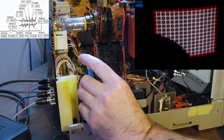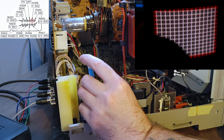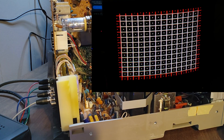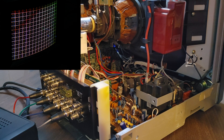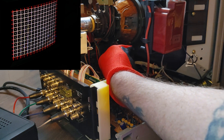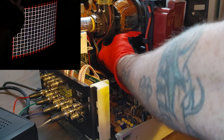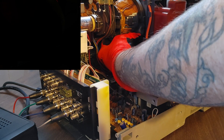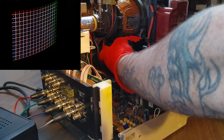Now I'm stretching out that vertical size. You can see we got the horizontal and vertical sizing down pretty well, but we need to bring that left corner down by turning that yoke. I'm going to crack that yoke nut loose — you can see that screwdriver is slightly magnetized and what it does to the picture. With that yoke loose, we can get our hand in here and carefully adjust that yoke till we get that image nice and straight. And we can get our bald head in front of that camera a few times.